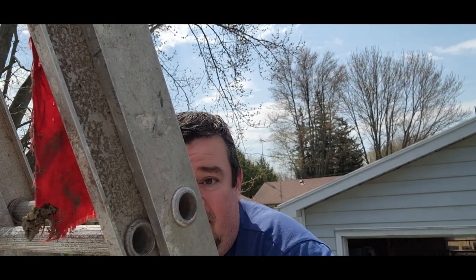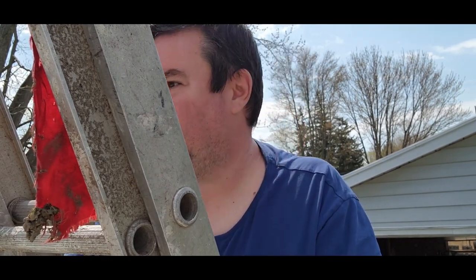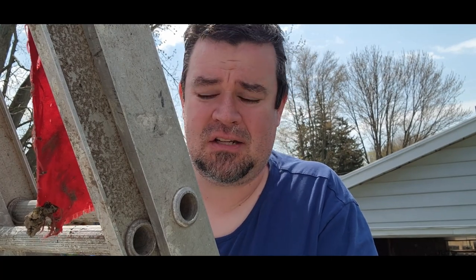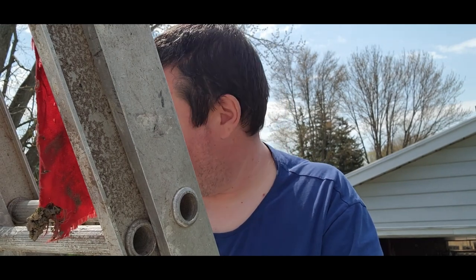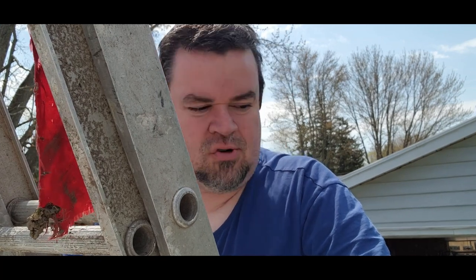You also want to very carefully get on a ladder and come up and inspect the roof of your camper. Now, I'd actually recommend not using an extension ladder like this one. It puts a lot of pressure on the ridge of your camper. Especially don't want to be putting it on your awning tube because you could dent that. You don't want to be putting it on the thin gutters because you could dent that. Even here at the back of the camper where it's like a plasticky, rubberized connection, I guess you would say, or edging, it could damage it. So really recommend that you invest in a good 8 foot, or 10 foot is even better, step ladder. That way you're not putting any pressure on the roof.